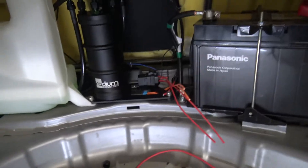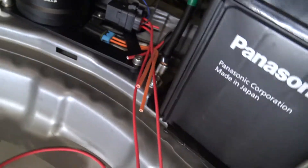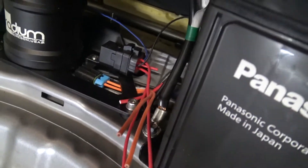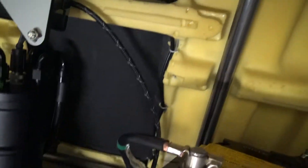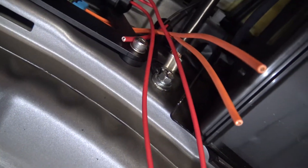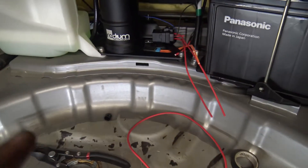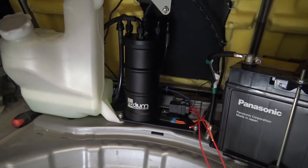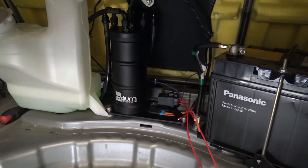Next up is the wiring. You have a relay and a fuse — the relay mounts on top of the bracket and the fuse holder goes on the bottom. The two orange wires: one goes to battery, one goes to relay power, which is one of the red wires. The other red wire attaches to the braided line that goes to the top of the fuel pump. The black wire on the relay and the black wire on that line will ground to where the battery grounds. The other orange line on the fuse holder connects to power on the battery and gives us power. The blue wire goes into where the factory fuel pump is and attaches to the blue signal wire on the trigger for the fuel pump — that runs both pumps.